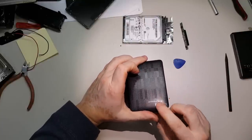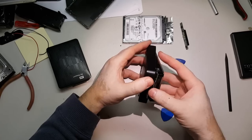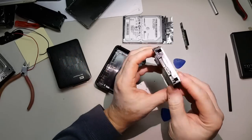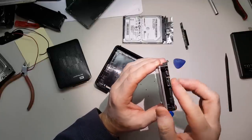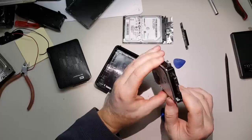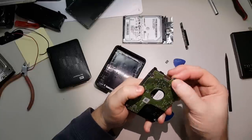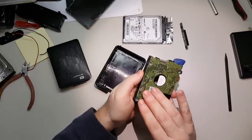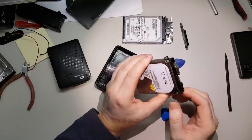For those people who have the My Passport, be very careful with it. Here's the Passport drive — as you can see, there is no adapter here. The USB is mounted directly onto the hard drive board. This presents quite a few problems: if the connector is broken and the motherboard is cracked or broken, it's really difficult to find a replacement donor board.